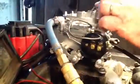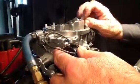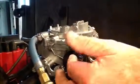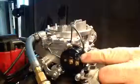The electric choke is right here. If the temperature gets below 45 degrees, you loosen up those three screws and turn that plastic — they're easy — until that choke goes there, then tighten those three screws back up. Plug your hot wire on here off the key and you'll be ready to go. You don't want it out all the time.